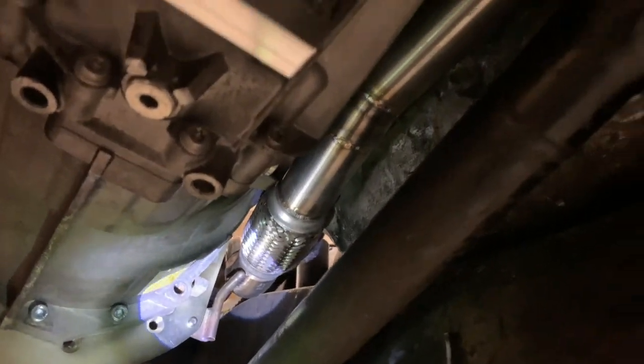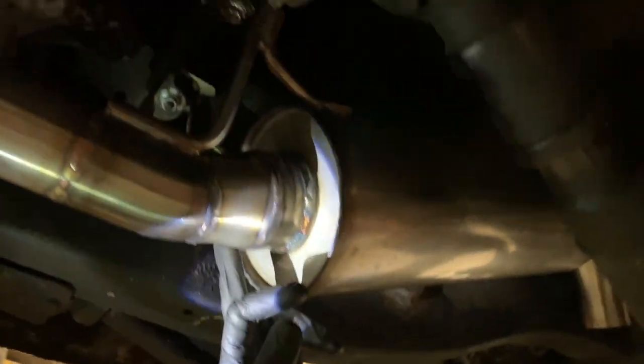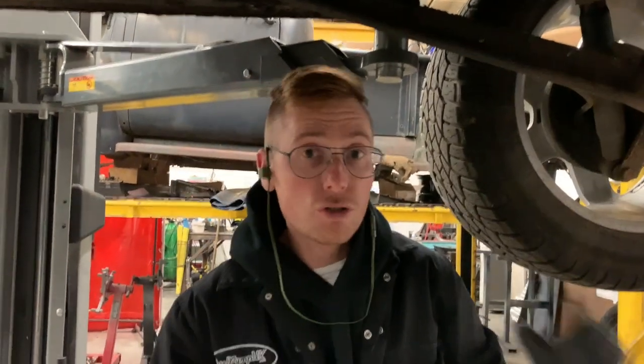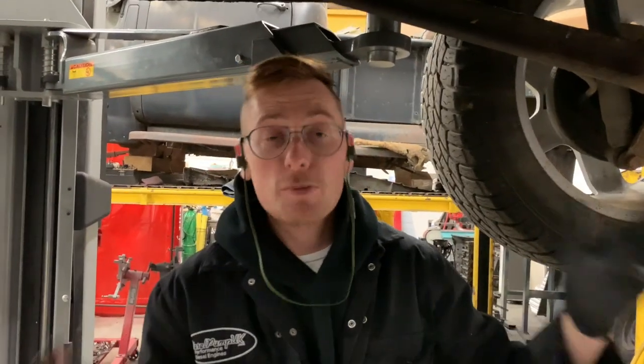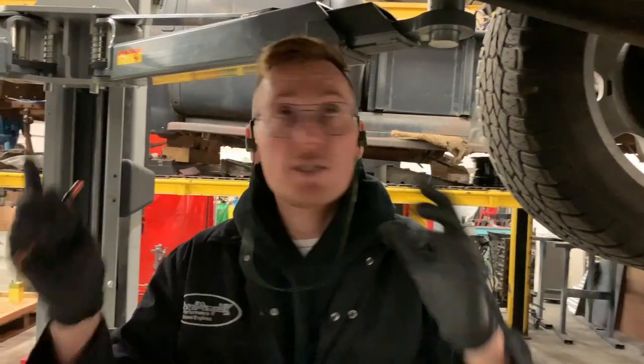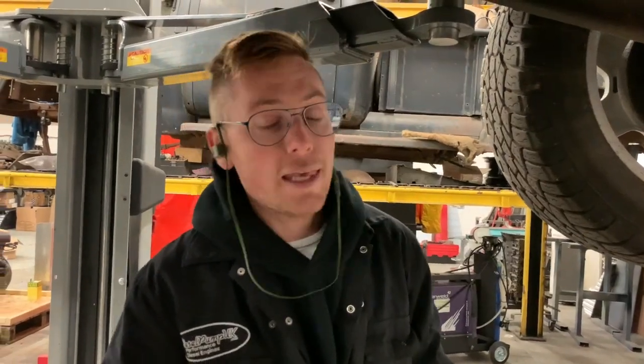And look at the exhaust. This is also finished today, so always have a flexi. This is 2.5 inch because this is a 300 horsepower setup, that increases to a 3 inch exhaust silencer and a 3 inch tip. If you want to build a system that doesn't drone, bigger is better. The larger the actual pipe, the less chance there is of the exhaust droning. So it's nicer to have that larger exit at the end.